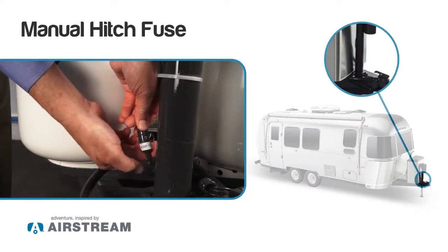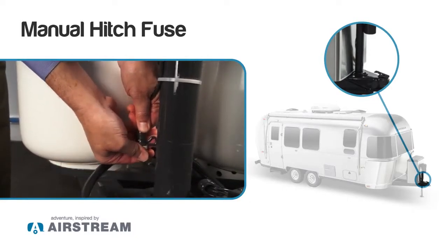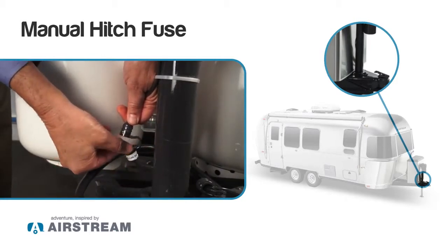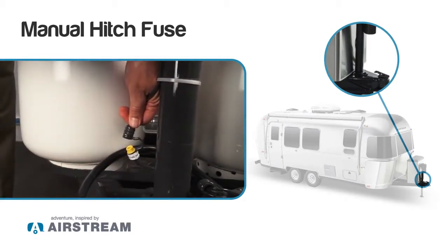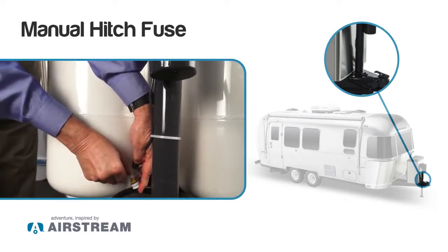On the side of the jack post there's a little fuse holder. It takes a 30 amp fuse. If you don't have any power, the first place to check, you want to pull this little plug apart, and it has a little fuse in there, and you're going to want to check the filament to see that it's not blown out.